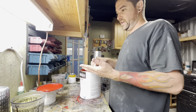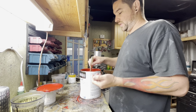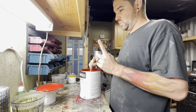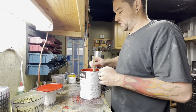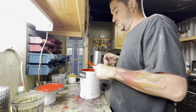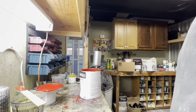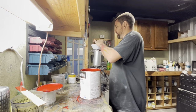And then when we are done with the bumper, we'll take our leftover clear and add a little bit of base coat to it. And then we'll either run one or two coats of clear coat over the taillights. The taillights were perfectly fine, brand new, so they really don't need buildup or UV protection or anything like that. So all you need to do is just get the tint on them. So if the first time you smoke your taillights, they look good, then you can rock and roll with it.